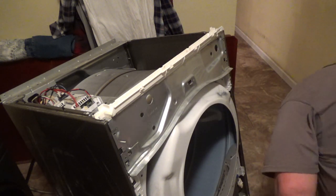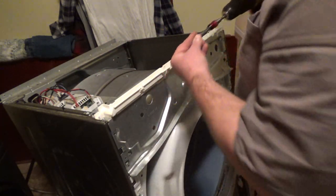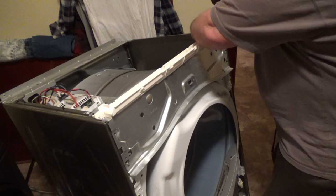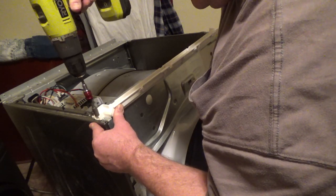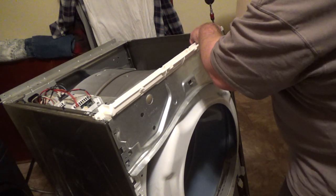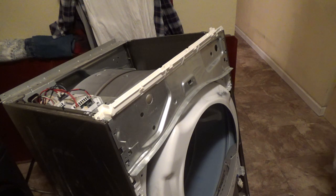It seems to me, I remember these being those weird cutting self-tapping screws. What I do is I spin the drill backwards first so I don't cross thread. When I feel it click one time, then I know I'm not going to cross thread. My drill also has a slip clutch on it, so I put it to a low setting. Can't remember if I put those screws in or not yet. Maybe you can evaluate things there.